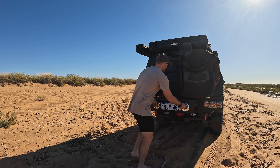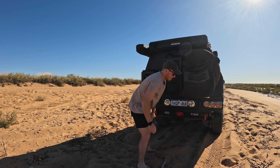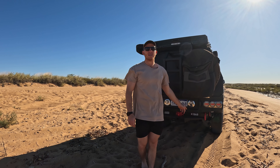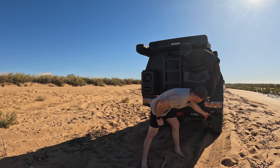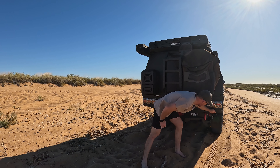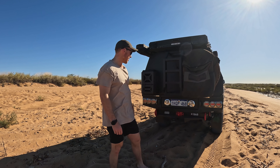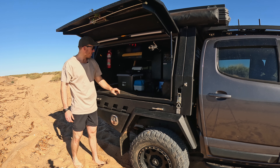The whale tails are lockable as well. There's a 40-litre water tank in the headboard so I've got taps running around the back - one's gravity fed and that one's actually plumbed into a water pump so I can plug that in and run the shower off that. That's why there are two taps at the back.